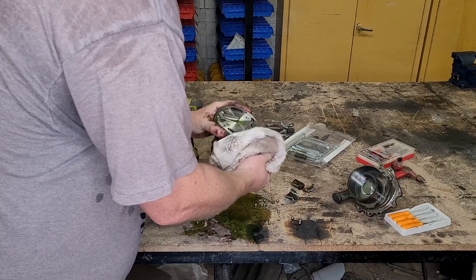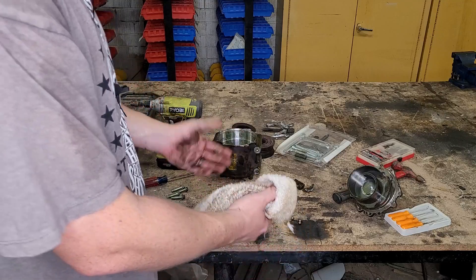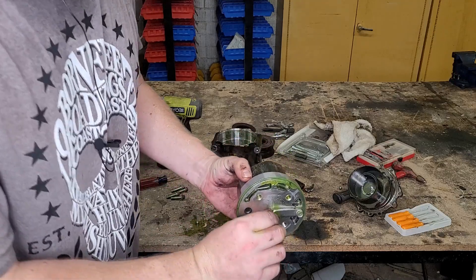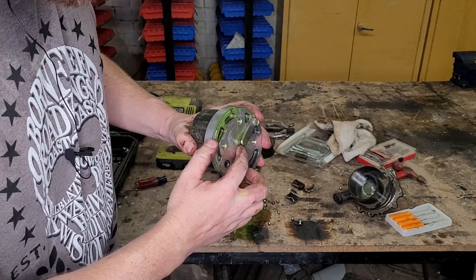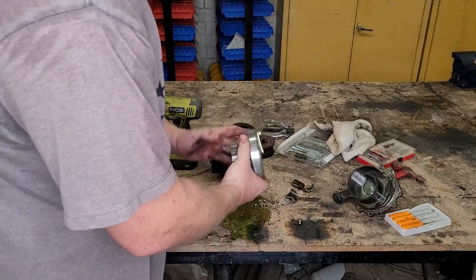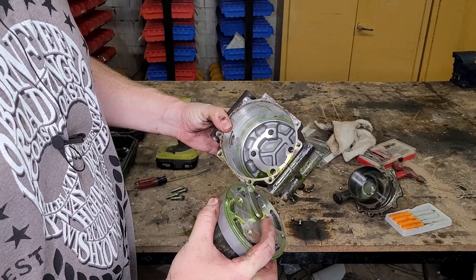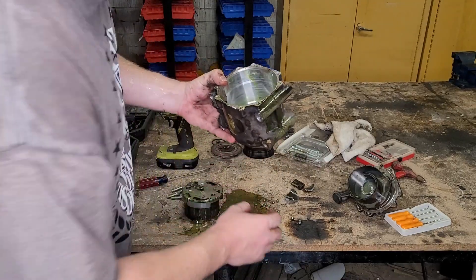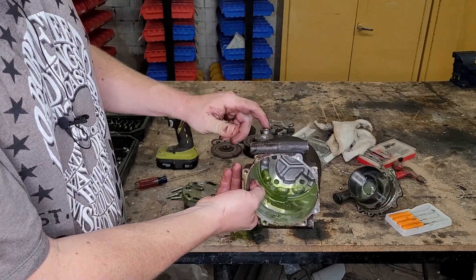Let's clean off this radioactive goop — I'm going to have differently-abled babies from handling all this stuff, and I'm doing it for you guys. So if you're enjoying this, hit that subscribe button. Back here we got a reed valve. See that? It's going to cover and uncover that port that leads to the high-pressure port. It's got an O-ring here that seals it to the case. The high-pressure fluid refrigerant comes out of here — can't come back because that reed valve would close behind it. So it's forced to go through that little tiny port in the back out to the high-pressure side.